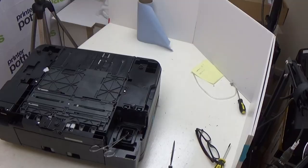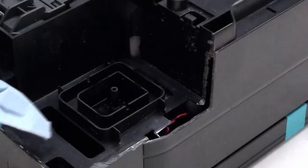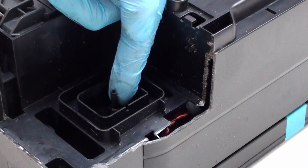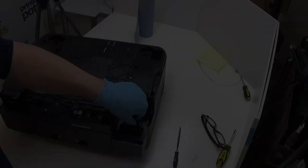You want to remove as much of that as possible. The next thing to do is disconnect that, get a little bit of kitchen towel, and then clean the outside of your waste tube. Get your piece of kitchen towel and just pinch on the outside and draw up, move around a little bit, go around the entire thing. Just gently pinch around, wipe the ink off, and repeat until you're happy that you've removed most of that waste ink.